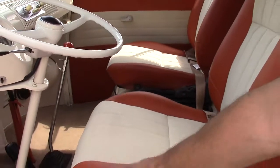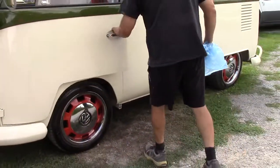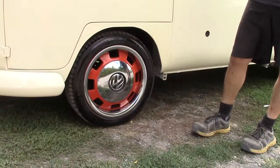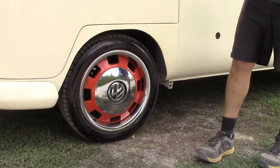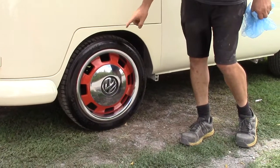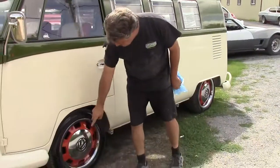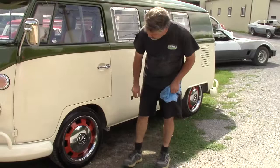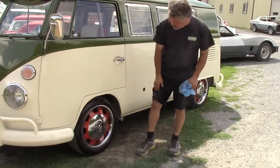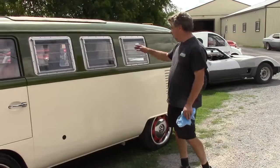which are very similar to the color of this leather. And those wheels turned out really nicely too. So those are retro wheels off of a newer, I think I want to say 2015 or 2016 Volkswagen Beetle. So we bought the 4 wheels, we sandblasted them and painted them that custom Porsche color to match the interior trim, and then we've got the nice wide chrome trim rings, and then we went with a really nice Michelin Pilot Sport tire for better grip.